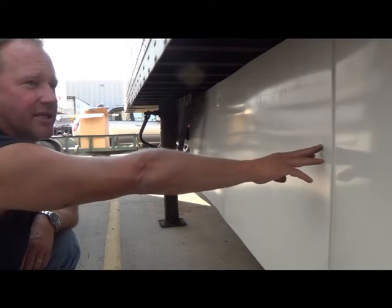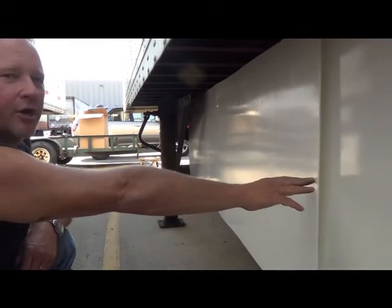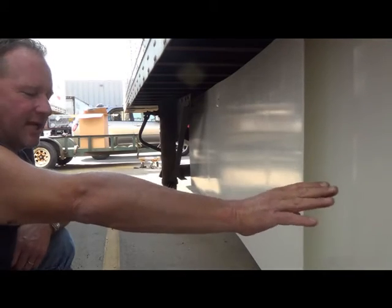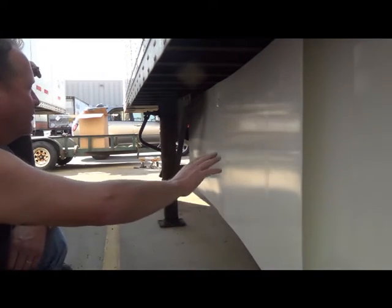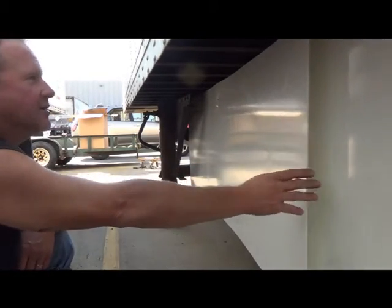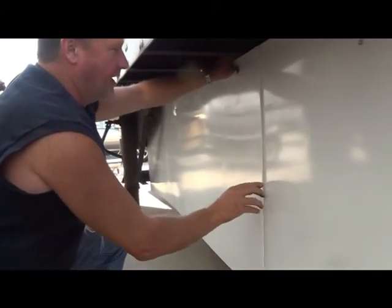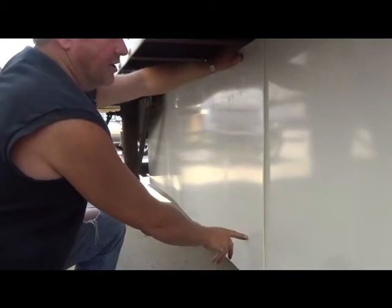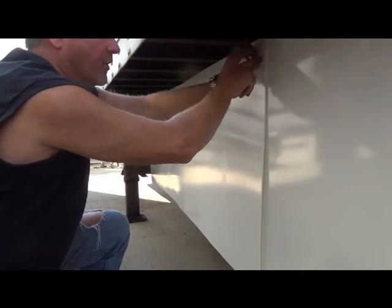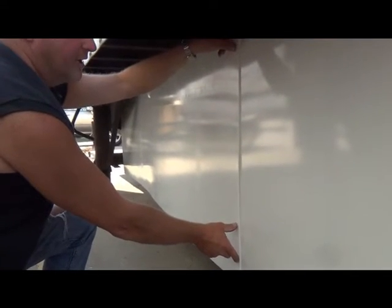That's why you have the 13 stanchion for each side, is it will accommodate this thing at an even longer position. Most trailers, though, you'll find the forwardmost position of the trailer tandem assembly and the landing gear allows for 23 feet. This right here is 24 combined. So the little bit of overlap here really isn't going to affect its performance. It's just going to overlap double, and it'll allow you to put the fasteners here. In the event that you have a large overlap where there is no stanchion, we recommend putting the same three fasteners just to secure those two panels together at their intersection.